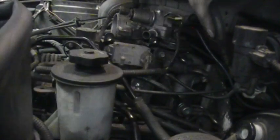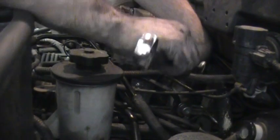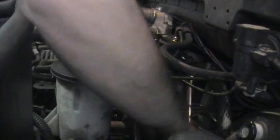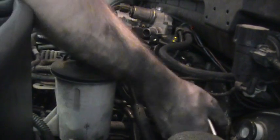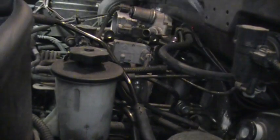Alright, so now I'm using my 1 1/16 wrench to install the nut that holds the flare nut that holds the exhaust tube. You can see in the picture that connects the manifold to the EGR valve. This is a bit of a pain, and you can't put the brake booster line in yet. And frankly, hindsight's 20/20, I really shouldn't have put the evap line in either. It gives you a little bit more room to move with the wrench, but definitely the brake booster line I did have to take off again after installing it because it was just in the way. So don't install that, and as you can see I'm bumping just about everything. That wrench is so long.